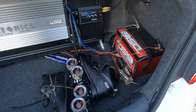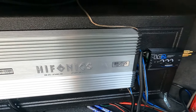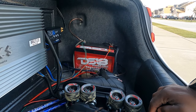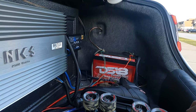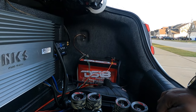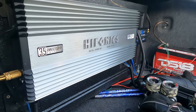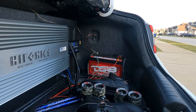This is the DS18 AGM battery back here — this is pretty much powering my system. Due to this being a hybrid car, it doesn't have a traditional alternator, so you're dependent on your battery back here, which gives me limited playing time. So I just ordered a Renogy DC-to-DC converter — it's a 60-amp converter. I'm hoping that can give me some juice to keep my battery charged. But it beats real nice — it does beat real good. You can definitely put a big system in a hybrid vehicle, you're just going to be limited as far as getting extra juice to that battery.